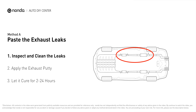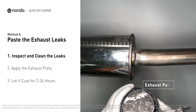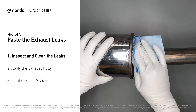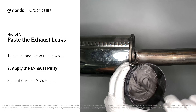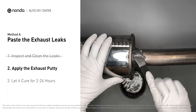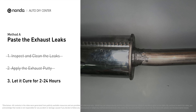Here are three of the most practical solutions to fix Ford's P0131 error code. Method A: paste the exhaust leaks. The exhaust system begins at the engine combustion chambers and runs along the undercarriage of the vehicle, eventually ending with the visible tailpipe. If you have a leak, get some exhaust putty to seal it up. First, get sandpaper and a wet wipe to clean the leaking area for better application, then stir the paste well to activate it.